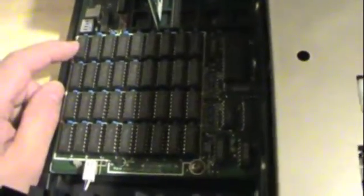In the old days, you didn't have SIMMs, DIMMs, or even SIP sockets. You had DIP sockets — DIP modules, dual inline package. These are fully populated, creating a 640 kilobyte bank of memory. That's what all these chips are for. The problem is one of these chips is obviously bad or malfunctioning.